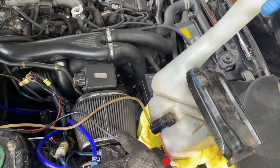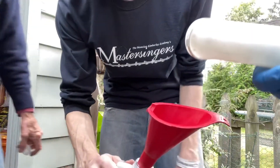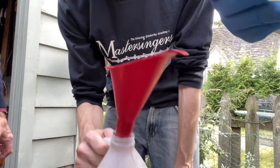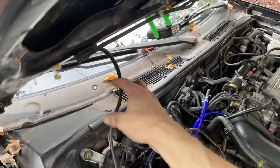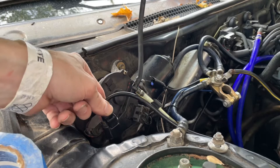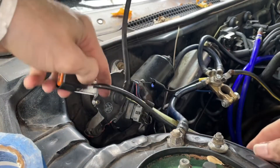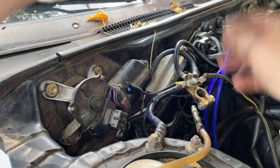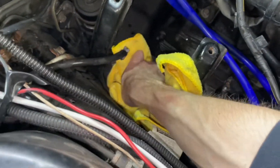Now I've got this up and out. I've disconnected the harness to the pump. You just want to drain the reservoir — this will let us disconnect the hose without spilling everything in the engine bay. One line goes to the hoses that tie into the wiper sprayers and then the other is an electrical harness. Push until you hear a soft click, pull and disconnect. So I had a little spill — that's okay. Go down there and make sure you clean up after yourself.